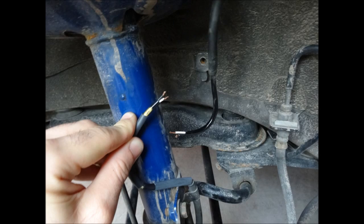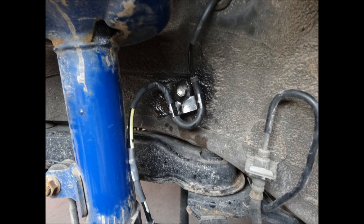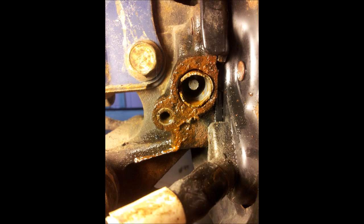For the first sensor I was able to find the broken wires by tapping in different locations in the cable and running continuity tests with my multimeter. After finding where the wires were broken, I just cut the cable, soldered the bad wires, and wrapped the cable back in some heat shrink tubing. On the other side, the wires were good all the way into the sensor, but the sensor was not producing a signal, so the only solution was to replace the whole sensor.